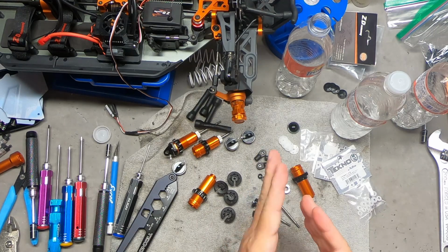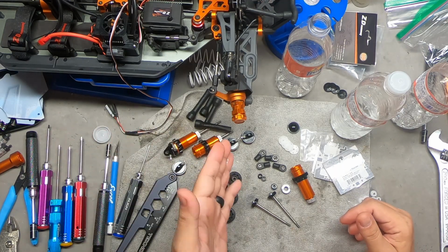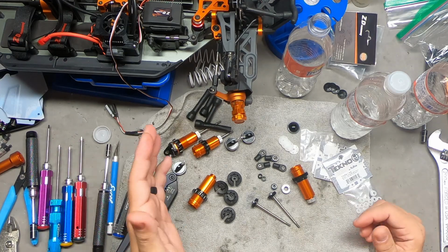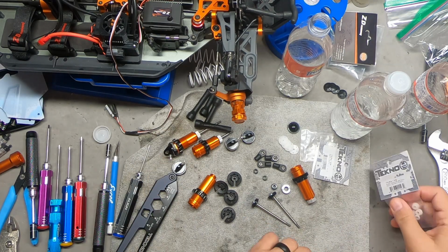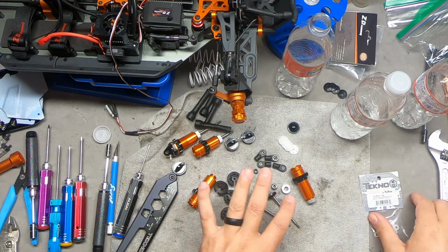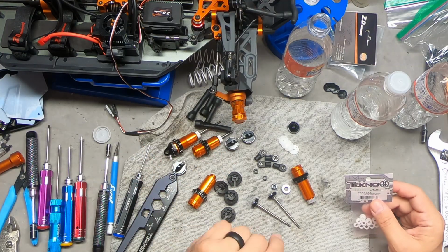So that's why you're supposed to have a spacer in between the O-rings. And in their exploded view, as I showed you earlier, they show a spacer there. And every shock absorber I've ever built that has dual O-rings, there is a spacer in between those O-rings. So that's what we're trying to accomplish here, is a proper setup. So this has nothing to do with tuning as much as making the shocks function reliably and sealing well.